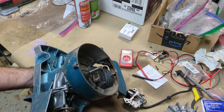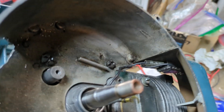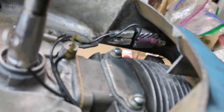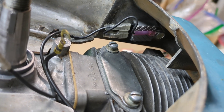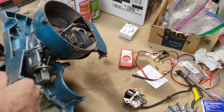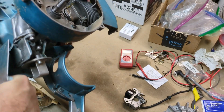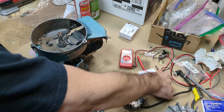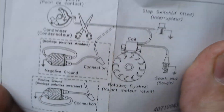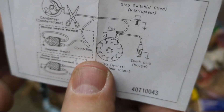Found a place to put the chip — see if you can see it. It's right up in here, there you go. The leg that's closest to the bottom is looped and grounded back to its own mounting screw, which comes out right here. That's all brushed up so it makes good contact, because we are doing a negative ground according to this diagram — it's the top one right here. So you can see the way this is working.